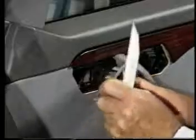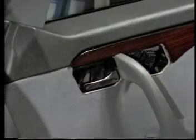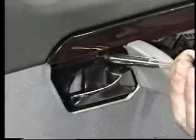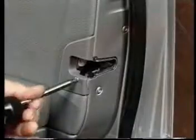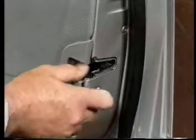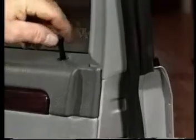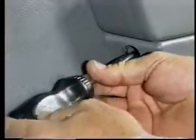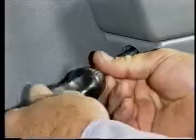The door handle backing plate is removed and the screw securing the top of the panel and grab handle is removed. The latch trim plate is removed and the door lock button unscrewed. This hidden screw under the armrest is removed. The location of this hidden screw is probably the single most important point to be aware of.